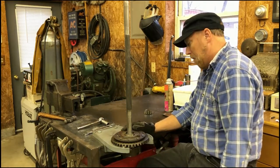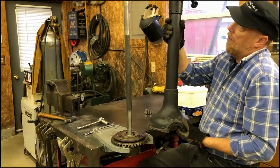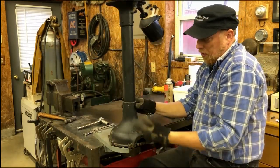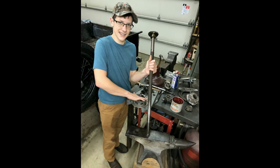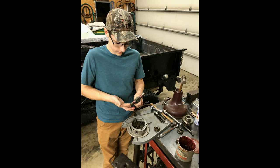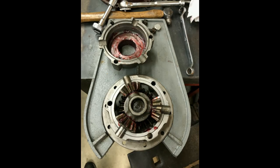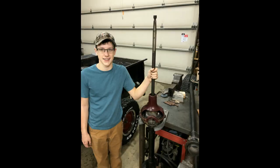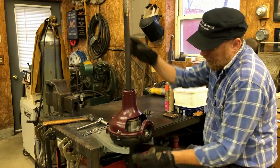So we've got that done. Now we'll move on to showing you how this goes together. Basically there's two halves of the axles. This actually goes down over this like that, and then you build the axle in two halves. So at this point we've started with the outer tube, and we've already put the assembled axles and the third member in.